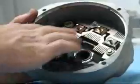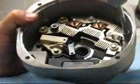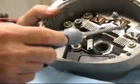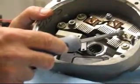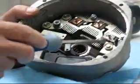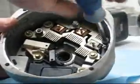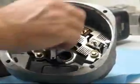Now we have all the components with the bridge rectifier. The first thing we need to do is take out all the screws that hold these components in. The upper portion of the bridge rectifier is grounded, so these are ground screws — these two upper screws would never be insulated because they're grounding the bridge rectifier. The bridge rectifier allows the AC current coming from the stator to enter and converts it into DC current. The DC is broken into two halves: the negative half up here and the positive half, which your battery pulse goes through.